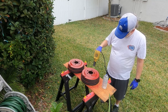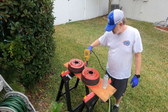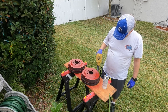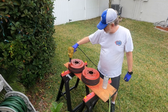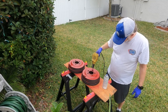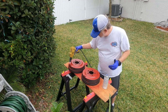It's just like the old bake places — the $199 paint jobs — they would bake the paint, and it actually makes it very tough. I've done this to a lot of stuff on my car and the paint becomes just a little bit stronger because you're giving it a good cure. You don't want to burn the paint off, but you want to get it hot. The other bonus is that you end up getting a little bit of a glossier finish because you cured it quickly.